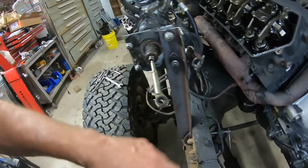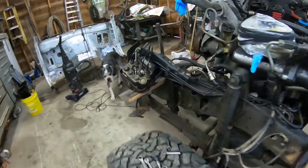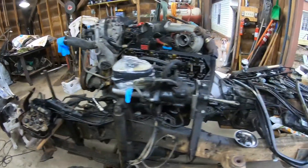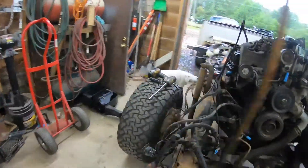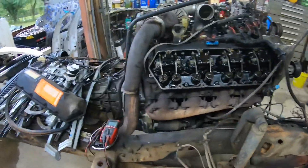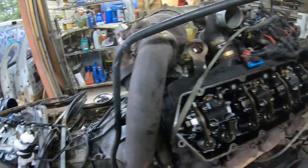I've got this out of that cab. I'm going to put my half-inch wrench in there and kind of lock it in place when I go to move it, to try to keep those tires from turning. So I've got to get in here and check these glow plugs — got them disconnected on this side.